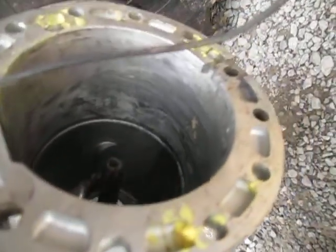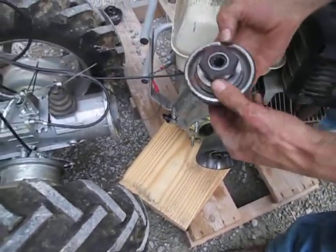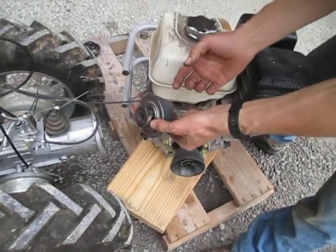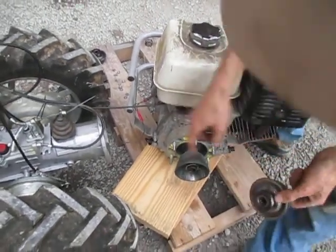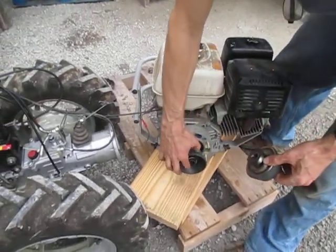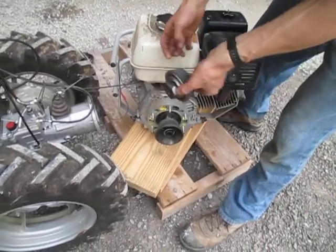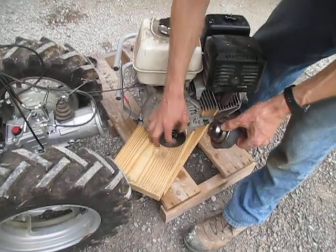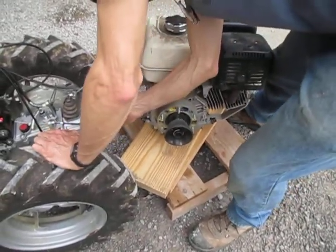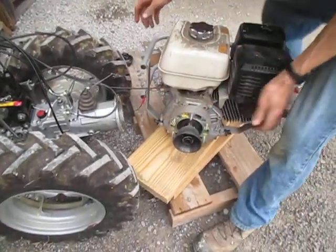There's a shaft down the middle of this — kind of hard to see. Before you slide the new clutch pack in place, it's advisable to take a little bit of grease and put it on the inside splining — not much. You really don't want much grease near a clutch, but you want a little bit of lubricity on there because that clutch pack does have to move back and forth. When it's completely dry it can get in a bind. So grease that up, slide it in there — it goes against the clutch linkage fork. And now we'll put the engine back on.